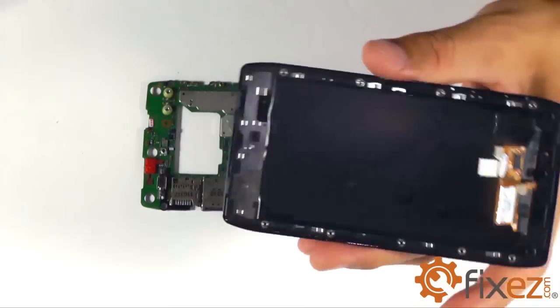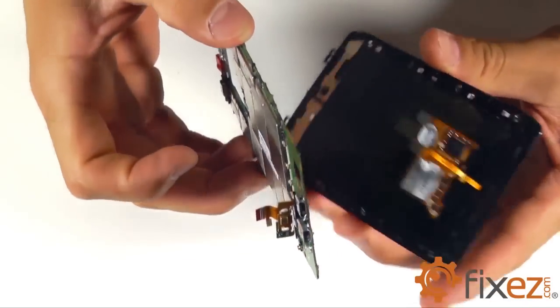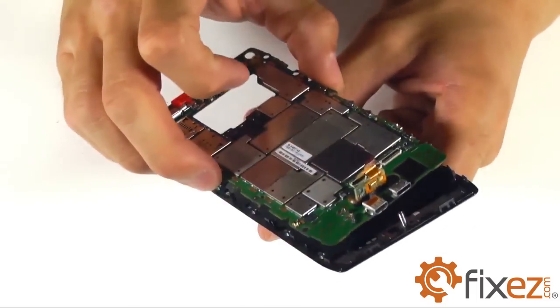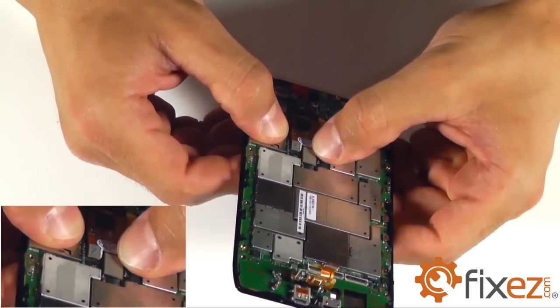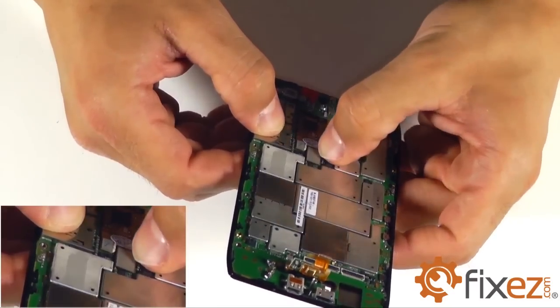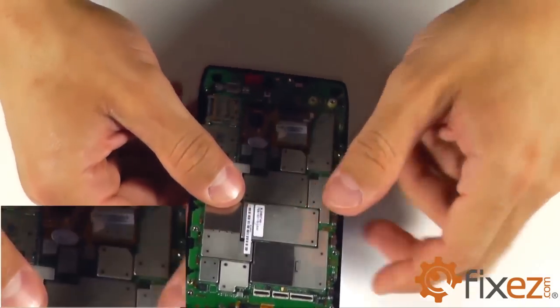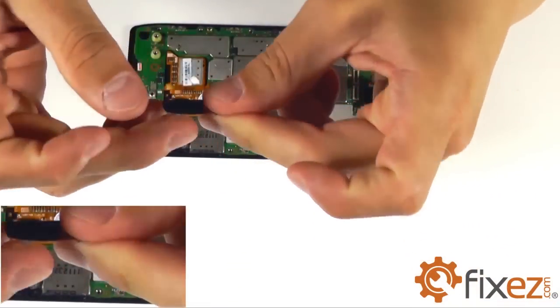And then we can align our motherboard with our ribbon wires on the display assembly. And we'll mate the 2 pieces together appropriately. We can go ahead and push down on our 3 display assembly contacts and plug them in. Here's our metal shield to cover up those connections.